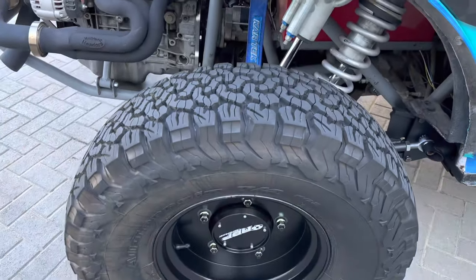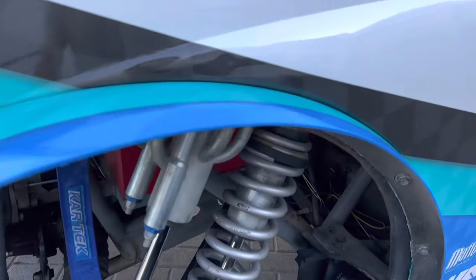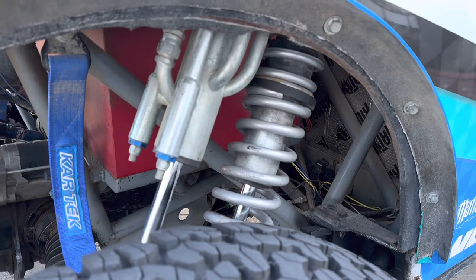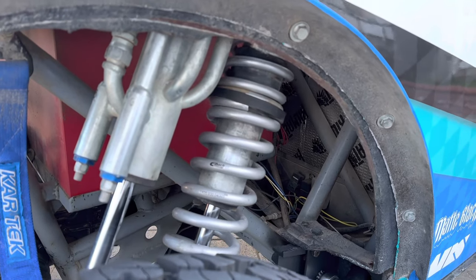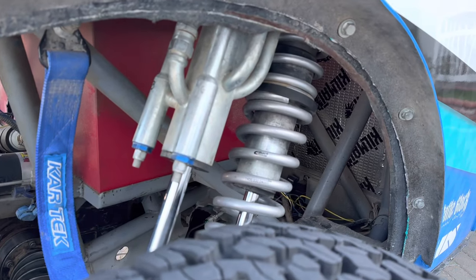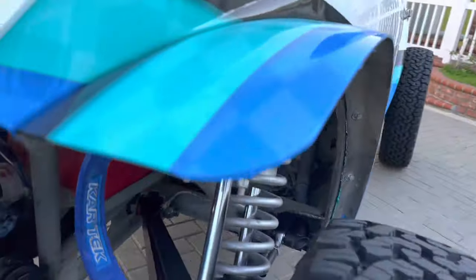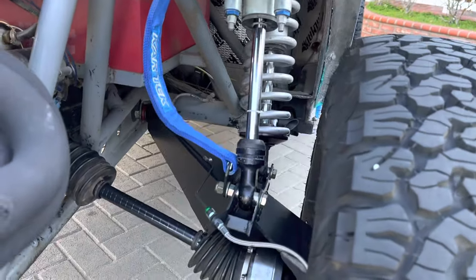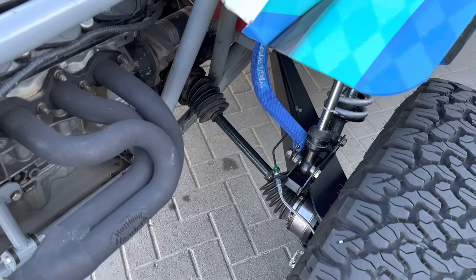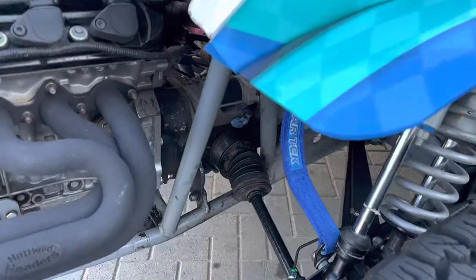That's all I could find, so I had some 16-inch wheels made. The rear's 33/10.50, same RBP brakes, micro stubs. I have a 2.5 by 12 Fox coilover with remote reservoirs, and some overkill 2.5 by 14 4-tube bypass Fox, also remote reservoir. Rear arms are 3 by 5. I think the axles are somewhere around 21.5 inches or so — chromoly.